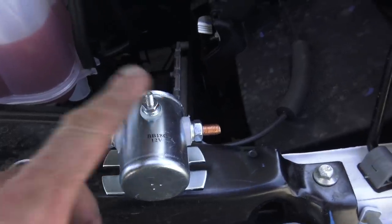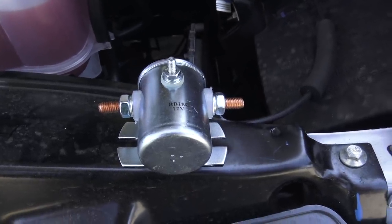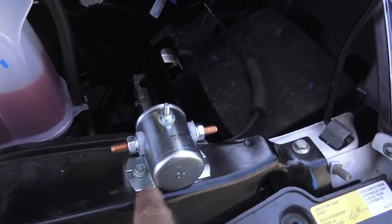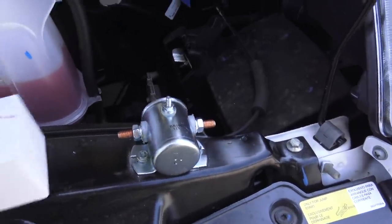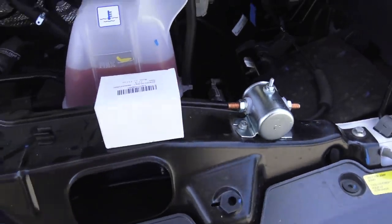And this is where we run a wire from a continuous ignition source inside at the fuse panel using a fuse tap, and I'll show you all that. I just sanded these spots and then used some self-tapping screws. Now I'm going to find out where to put this breaker in a place that makes the most sense.